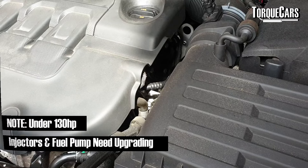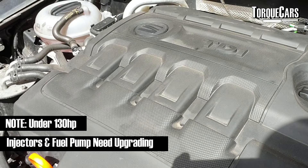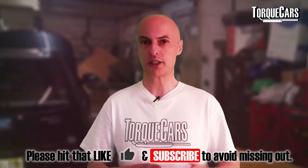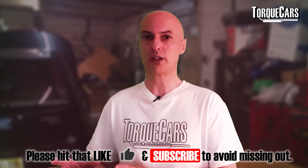For pre-2010 engines with the 110 or 120 horsepower version, you need to get those injectors upgraded. The fuel system on those was basic — built for economy, not power. Although the engines are predominantly the same as higher-powered versions, the fuel system was definitely lacking. In order to get any meaningful headroom when mapping, you need that fuel system upgraded with injectors from the higher-powered versions at the very least.